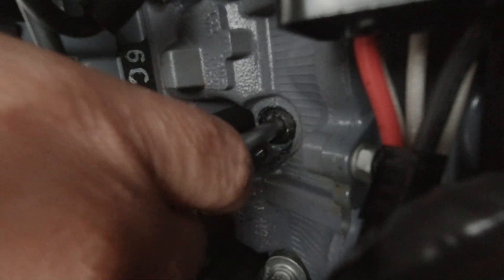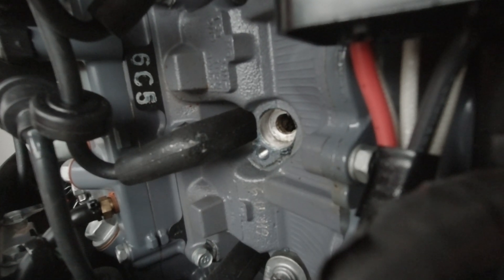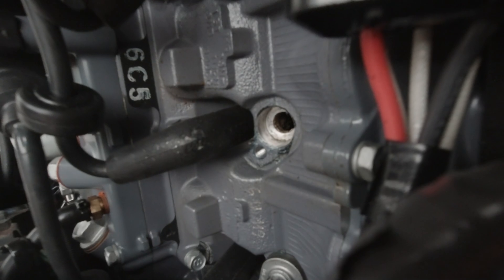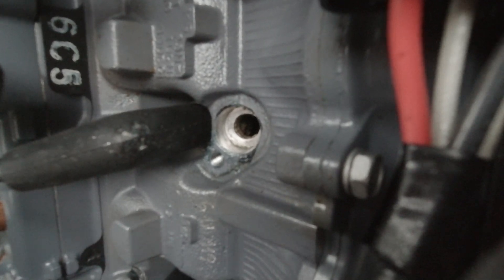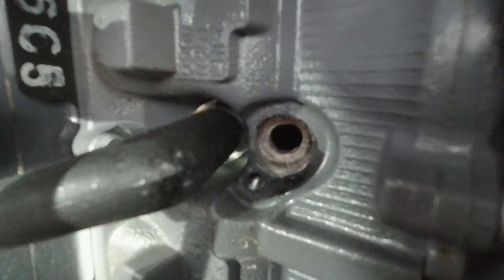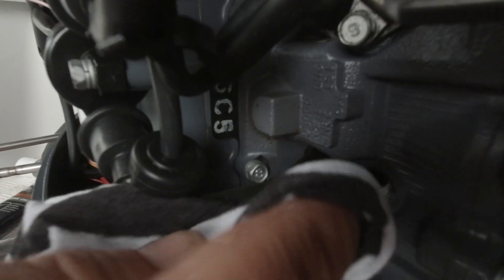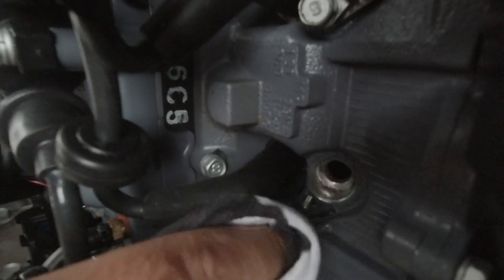Fairly easy to come out, just a bit fiddly — now she comes. Get out our torch and have a little look inside, make sure there's no little bits of anode floating around. Because I put grease on this last time, it's all nice and clean in here, no corrosion. Just give it a quick wipe to get all the little bits of old grease out.